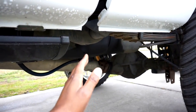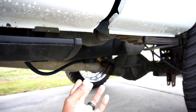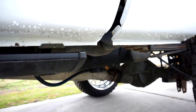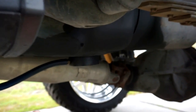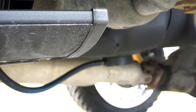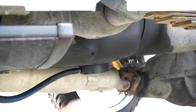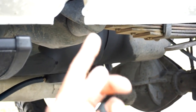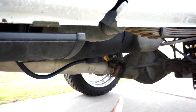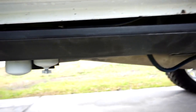This sounds contradictive but hear me out — you're sucking out any bad contaminants from the bottom of the tank, because things like to settle to the bottom. Your filters should catch them, so that means you should be maintaining a pretty clean tank on the inside. Another thing popular with sumps is the quarter tank issue. On older trucks like your second-gens and early Power Strokes, at a quarter tank the truck cuts off because it can't get a solid stream of suction from the straws to pull up to the sending unit. A sump will eliminate that quarter tank issue. On newer diesels you don't really have to worry about that on the stock lift pump, but it's still a relatively inexpensive investment with multiple benefits.